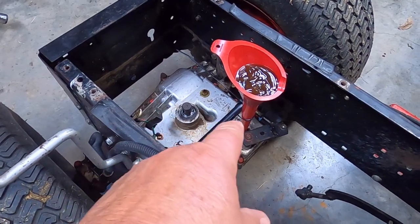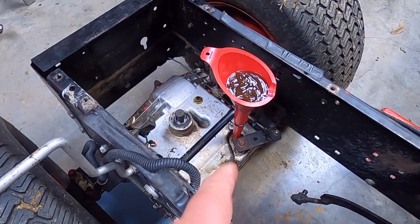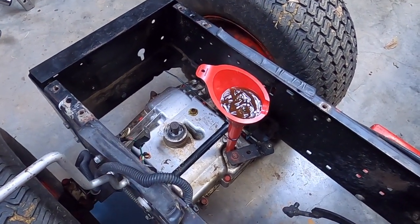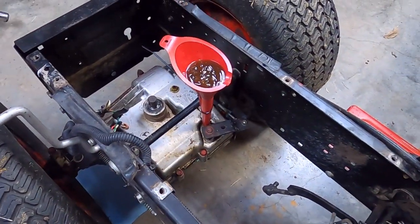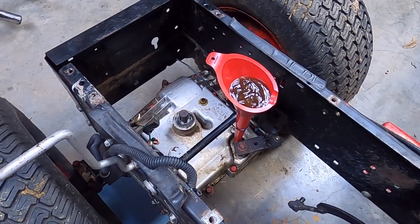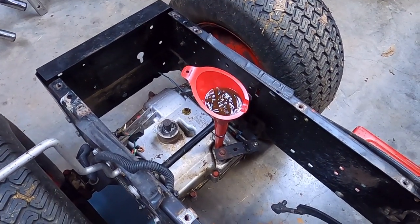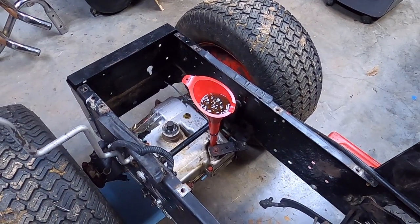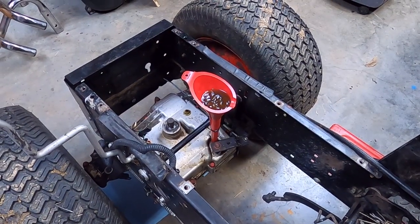Very very slowly that's going to bleed down into the axle until it doesn't take any more, then I'll plug it up. That'll be greased for the whole summer. I put blue paper towels down around the axle seals because it's going to leak, but this keeps that transmission going and going. I'll go ahead and put this one together. Once I get my steering parts in we'll do the steering assembly - thanks for watching.